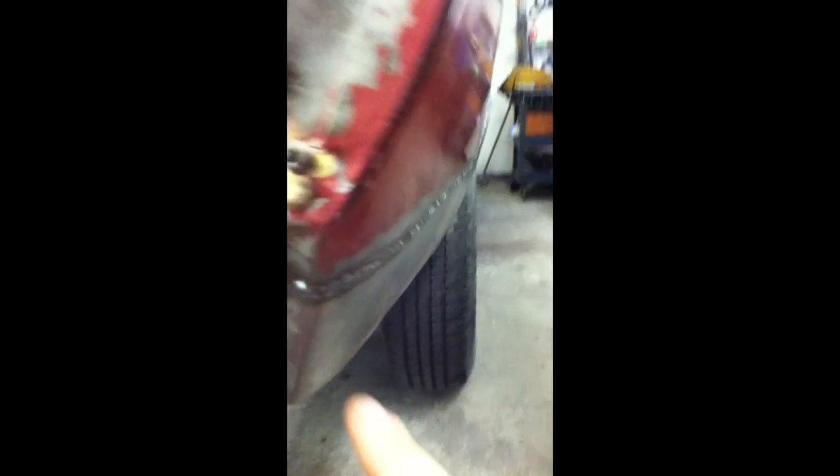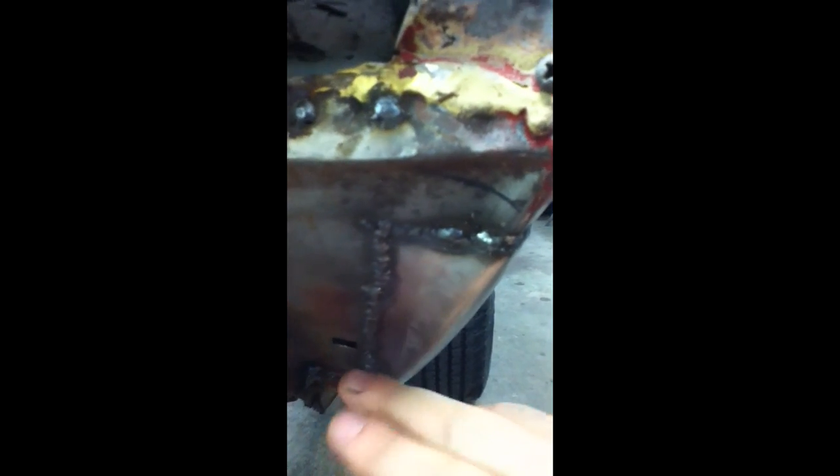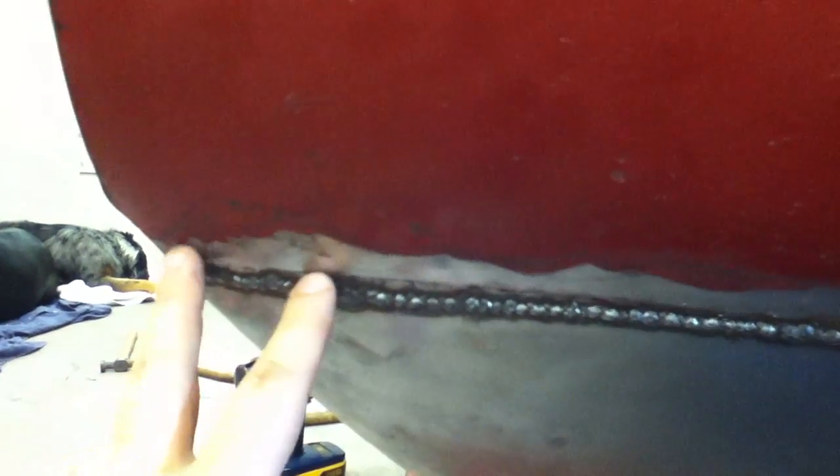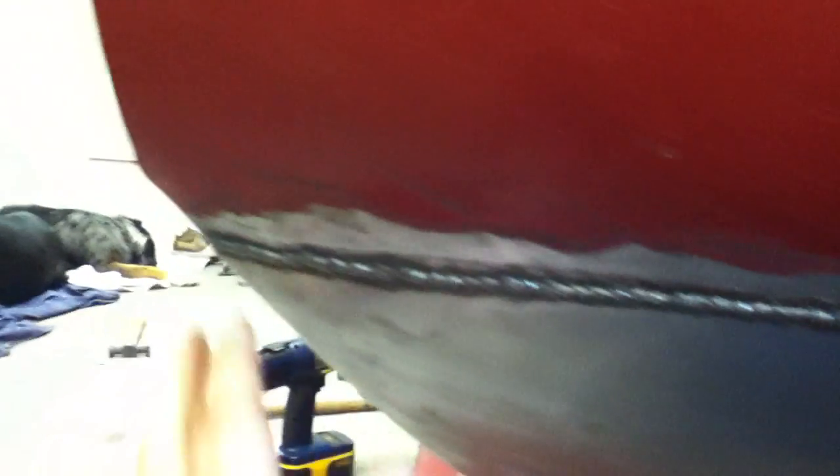This is the side I flanged — the lower quarter panel on the passenger side. If you look closely right down the line, it's got like a half-moon shape right in here, and I'll explain why that's not ideal but it's pretty much required for every flange. For the back end piece I butt welded instead because you don't ever see it, and the way these are moved and shaped you always end up with gaps back there. When it comes to flange welding, the best way to start is get your corners right — get your corners here, here, up on the inside, and the same thing with the back.